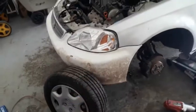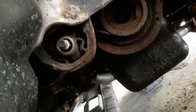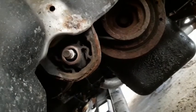I got a front bumper cover — those are pretty rare to find at the junkyard. This car when I bought it did not come with the AC belt, so obviously the AC doesn't work. The previous owner actually told me about this — said the car doesn't have an AC belt for some reason. My first thought was that someone took it off because the condenser or compressor was busted. I went to put a belt on to check, and found out you've got to remove the engine mount to get the bolt off. They had cut the belt but couldn't put another one back on because this engine mount is all rusted out — it's a Canadian car.